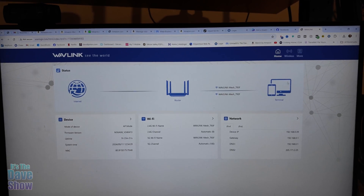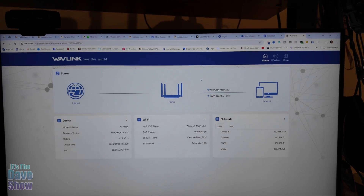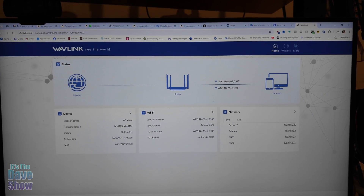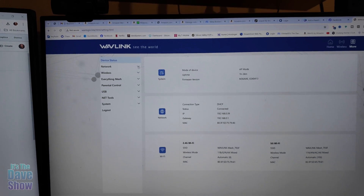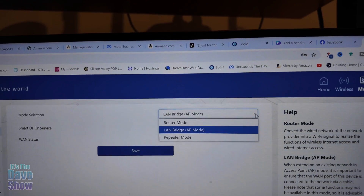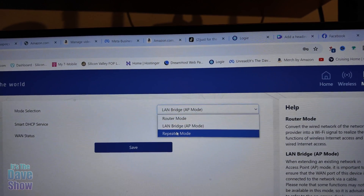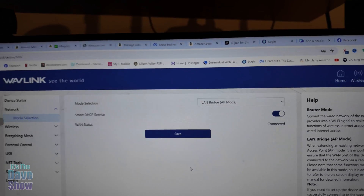Here's the desktop computer — I'm showing you the app. It looks a little different than in the instructions, and the instructions are kind of small and hard to see, but once you get it up it's not bad. I hit the More button, went to Network, and there's a mode selection. Up here is AP mode — that's what I switched it to. I tried repeater mode again but it didn't work very well, so I switched to AP mode and saved it.